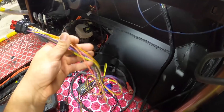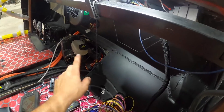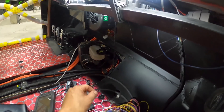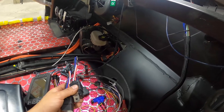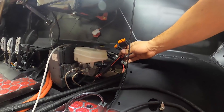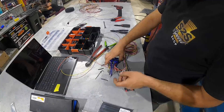I'm finishing out the B-side connector for the smart wire that's going to be running the drive unit in the front, the brake booster, and the power steering pump. It's going to have two relays to switch the polarity out of the smart wire. I have two other ones going to the rear motor already, so I'm going to mount them in the same area right on top. I have a 12-pin here, and this connector is going to send pedal positions to the front motor.